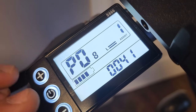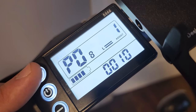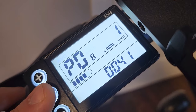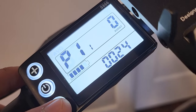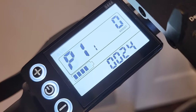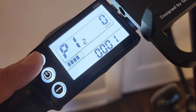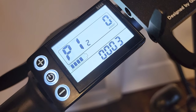P8 is your speed unlock setting. Set this all the way up — it goes up to 41. Bring it to 41 to get the full speed. This is how you unlock the top speed of your bike. P11 is the sensitivity of your power delivery, so set that all the way up for maximum power instantaneously. P12 is help intensity settings — set that all the way up to three for as much intensity as possible.